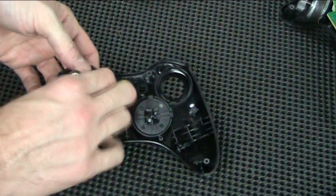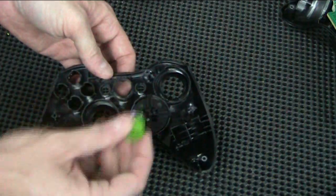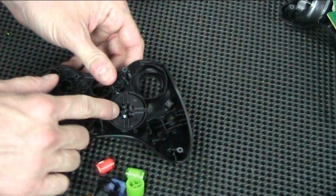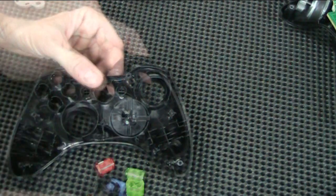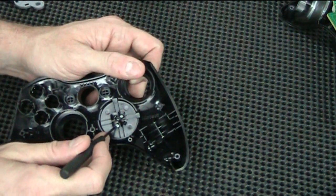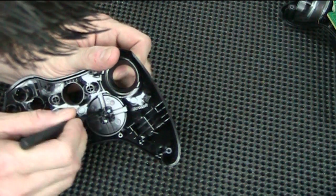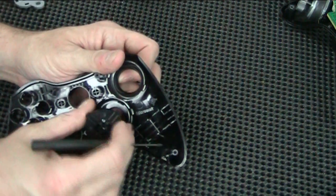Make sure you take all the buttons out. You've got the four colored buttons, the start button, and then the pad. For the pad, you need a jeweler's screwdriver to get down in there and unscrew those screws. This little game pad is held in by two screws, and then right in here there are two little lips — if you just push them in, it'll pop right out. There's one on one side and one on the other. Make sure you don't lose your screws; there are two little silver screws.